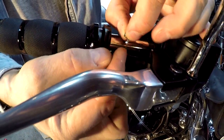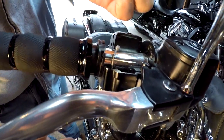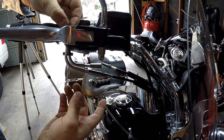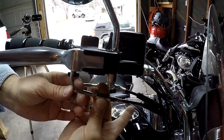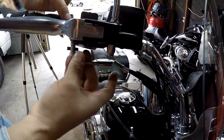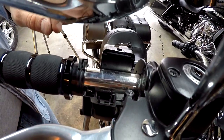It's got a notch in it, so you twist it — roll the barrel 180 degrees and it comes off; that's what you've got to get off. The reason we had to do that is because you can only back this off so far before your throttle gets tight, since it pulls the ball and your throttle will stop. So now we can back this up all the way until it comes off and we can get our lubricant down in there. Without taking the housing off, there would be no way to get this loose down below to get the lubricant in.